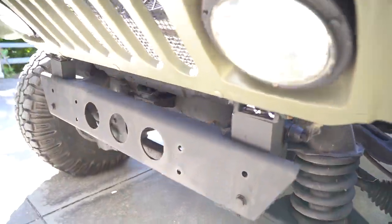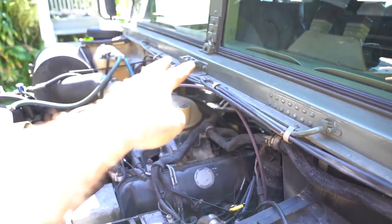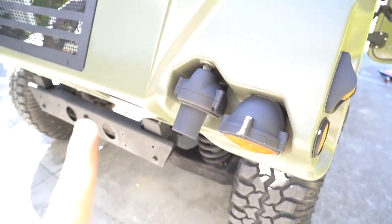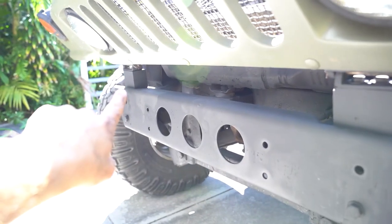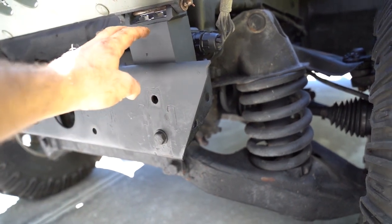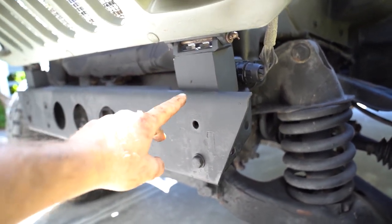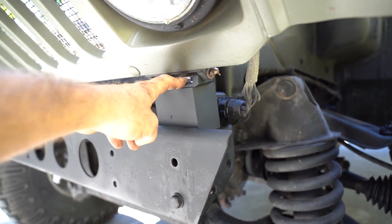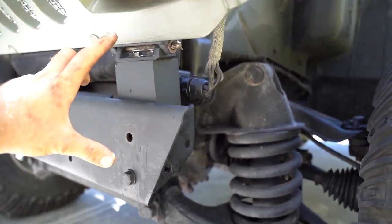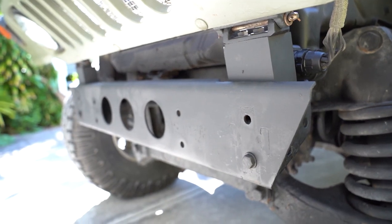These are the front lift blocks for the hood. I was confused about whether you need to change this sort of stuff — no, those are fine, you can leave them. But what has to be changed is this, so the hood fits. Whatever lift you go — these are 3 inches — 3-inch blocks. I just drilled new holes, went to the hardware store, got the same bolts that came off — they were very rusted and hard to get off, but I was able to with a torch and heat plus penetrating oil. Take the old bolts to the hardware store, get ones that are 3 inches longer, and drill holes in the blocks to fit them. I laminated up some synthetic decking, cut it square into a nice solid block, drilled holes through it, and bolted it up.